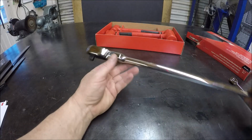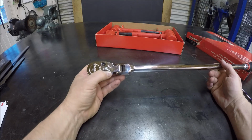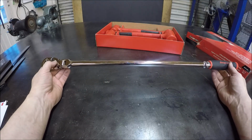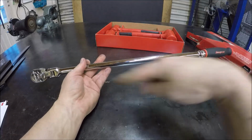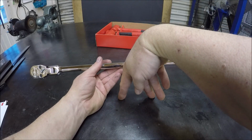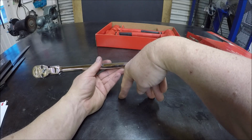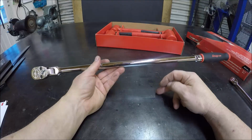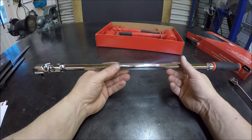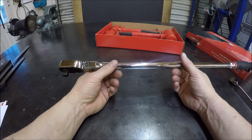And helping my buddy Brad replace the coil-over struts on a Honda Element was a royal pain, especially the back, because it's kind of in a macaroni noodle, and it comes down, and the bottom stud is hard to get to to begin with. Number two, unfortunately, it is metal sleeved, and the fastener, or the bolt, running through it had totally rusted, and we could not get it out. We ended up spending about 3 hours just grinding and cutting and totally destroying it to try to get it out.